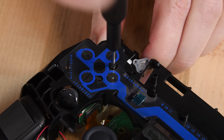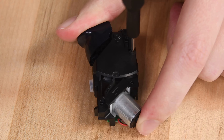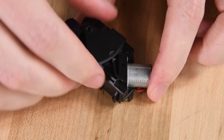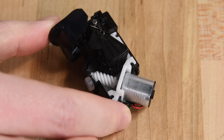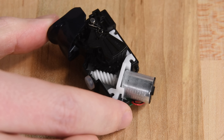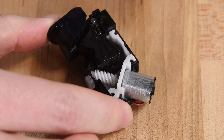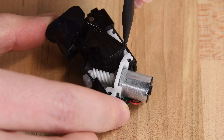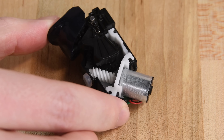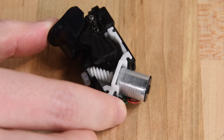The adaptive trigger modules are secured to the black frame with two Phillips screws each, and four more Phillips screws hold the module itself together. The trigger works normally without all the fancy mechanics, making contact with a button attached to the blue ribbon cable. But if game developers choose to, they can program the controller to adjust how difficult the trigger is to pull. The silver motor spins the white spiral gear, which moves the black arm up and adds resistance to the trigger's lever action.